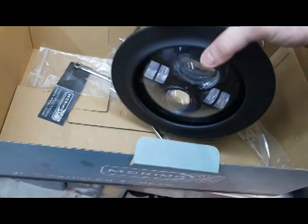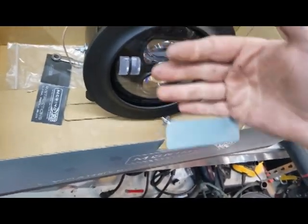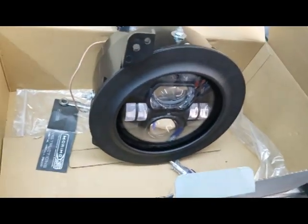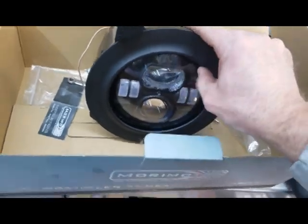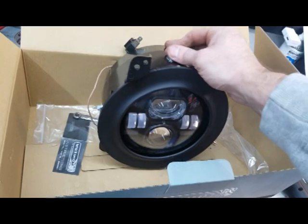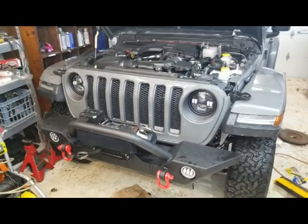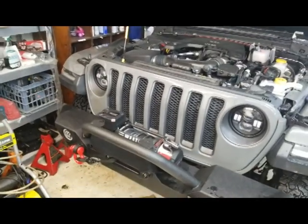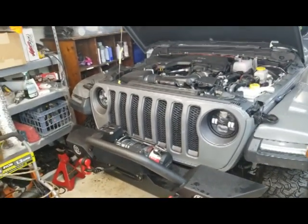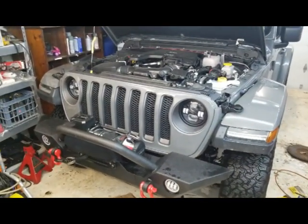Here's the thing with gap: when I just drop the adapter into the bucket without adjusting, look at this big half-inch gap all the way around. That's why you leave these loose and run the screws out - which puts your aim all cattywampus, but it doesn't matter because you're gonna have to aim them anyway. My two cents: you need to move them forward if using a normal sealed bulb like this. Obviously the slots are there to accommodate different depths of different headlights. Slammed the grill on and it looks pretty cool - kind of that murdered-out look, darkened up the front.